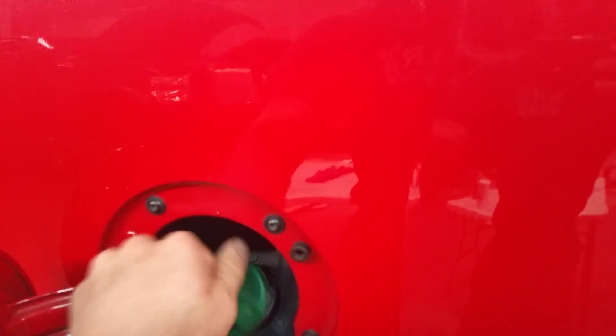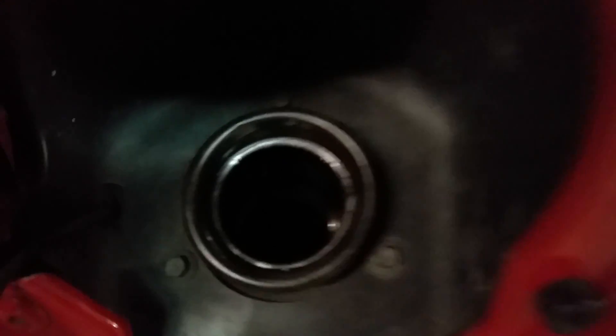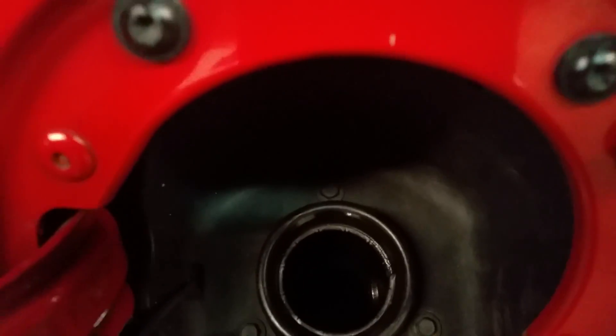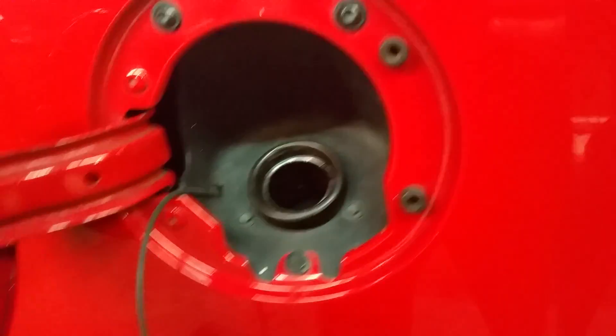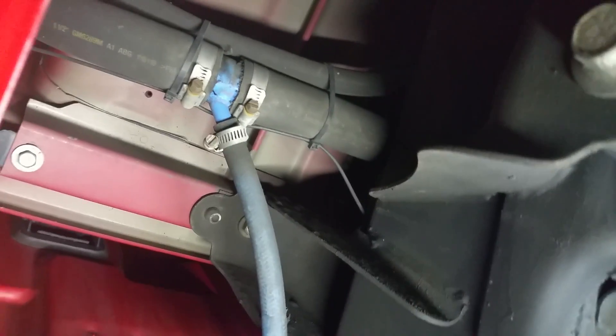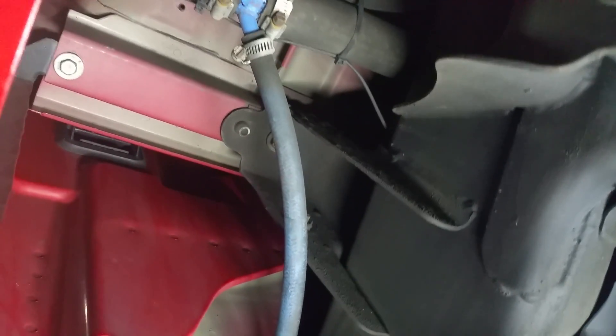I'll show you one more thing. If you look at the fuel system, the fuel regularly recirculates back to the tank coming off the titanium unit back through here, which I'll show underneath. That line goes back into the fill neck, and that's where your fuel and air is returned back into the tank, and that's where the air is extracted from your clean fuel supply up to the CP3 or the K16 or whichever application it may be — in this case, it's the CP4.